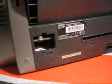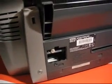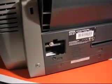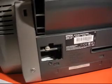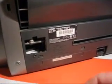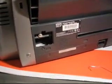Okay, we've now got the panel off, and instantly when you're doing this, it's a good idea to have the printer on some rough material that doesn't matter if it gets damaged, because we might get some leakage of the ink here. Now what we've got to do is to reach down in here and try and find the pipe that expels the ink when the heads are being cleaned. Now what I've done in order to get that is to make a little tool. It's just made out of a paper clip, and the idea is we can pop it down here and pull out the tube.